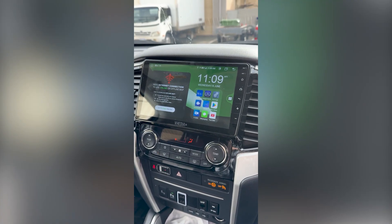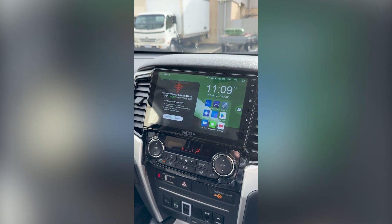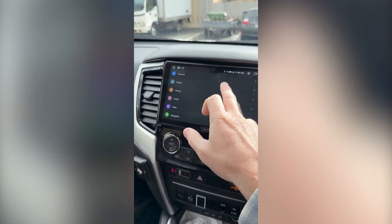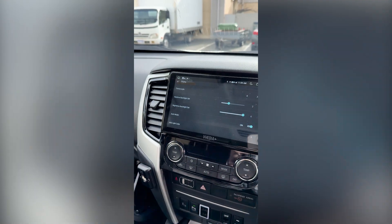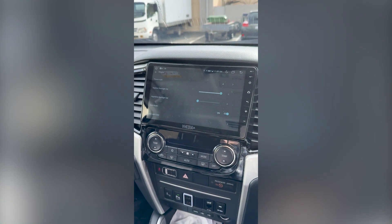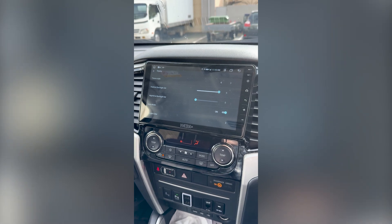Here's the head unit — if I turn the car on you can see it went to night mode and then back to daytime. That's the head unit picking it up. Normally you'll have a couple of settings under Display. If I turn the night brightness down and the day brightness up, when my headlights are on it's a bit dim, and it comes back up when they're off.